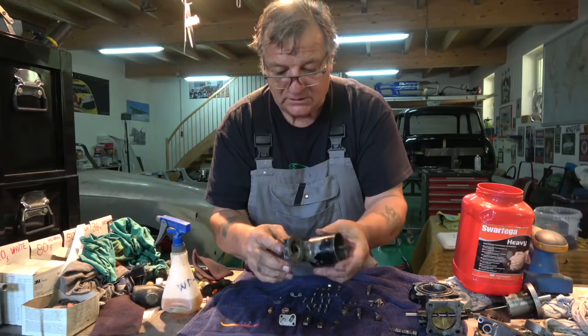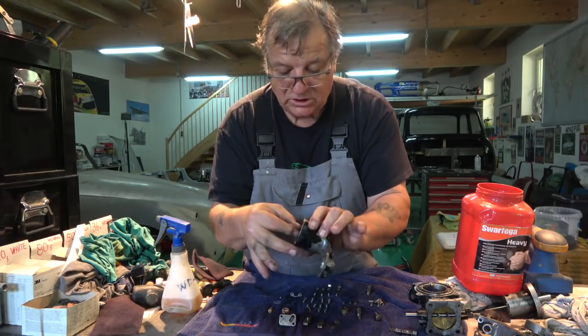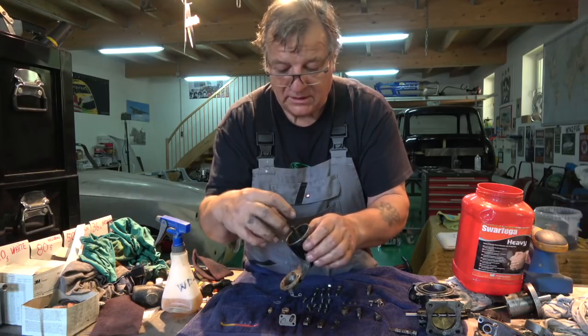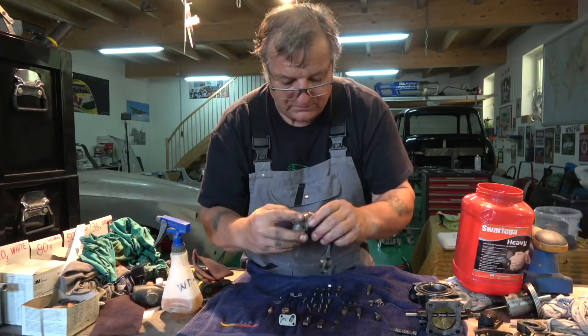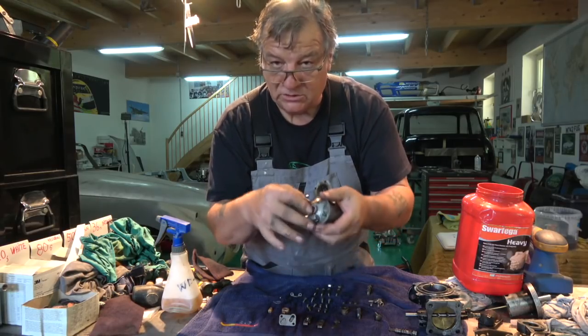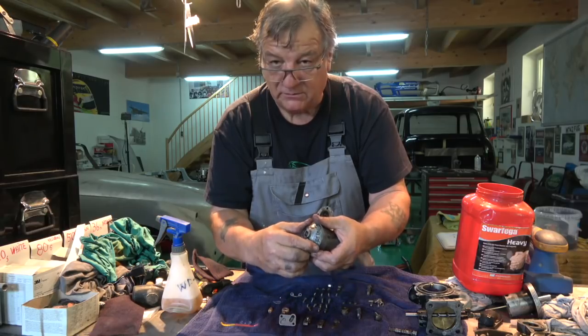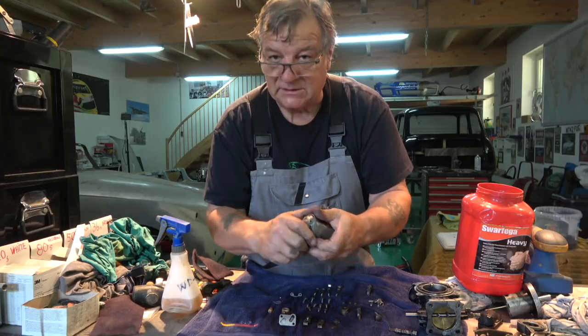Two common problems with these fuel bowls, on all of them, minis as well, is this shaft where the float goes up and down on, and the top is put back on here, are terrible for snapping. So if you can, make sure you immerse these in some kind of fluid for a few days or weeks if you have to. Once it snaps, that's it, you're done.